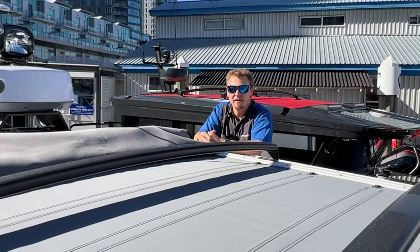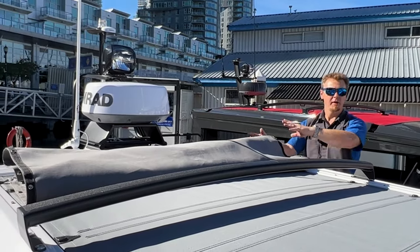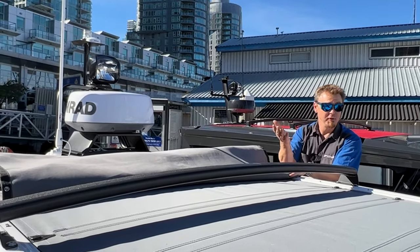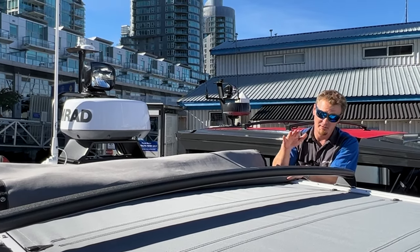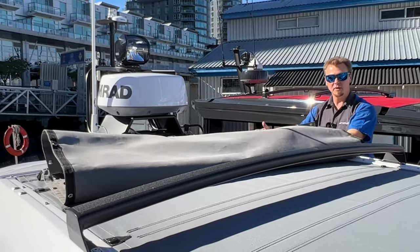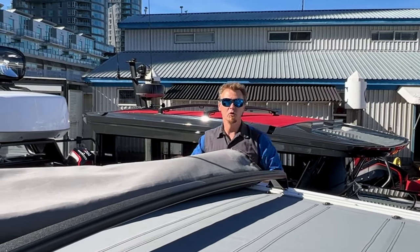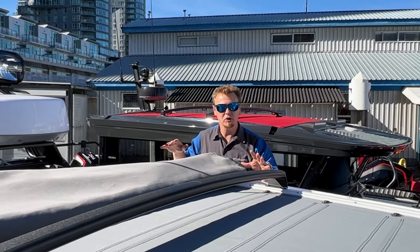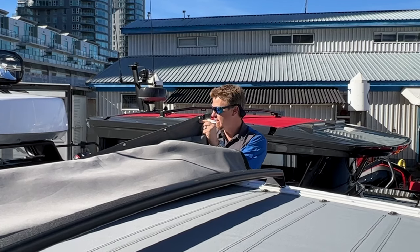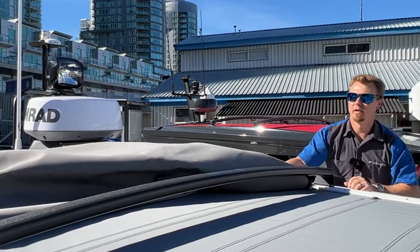Here we are with the canvas — I've rolled it into a nice roll. It's much easier to work with that way. Like a USB plug, there's a 50/50 chance of getting the orientation right, and everyone knows you always put it in wrong the first time. These canvases aren't quite symmetrical — in the aft corners the snap is slightly inset from the edge, whereas the forward snap is all the way in the very corner. Once you know which end is aft, put one snap there, then roll it all the way down and snap it all back into place.